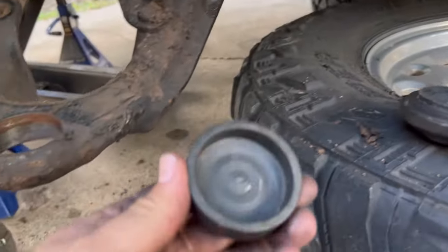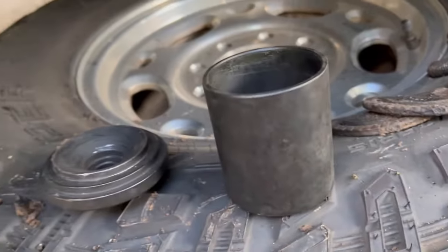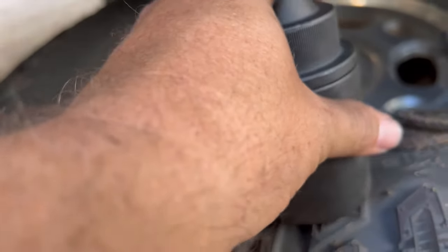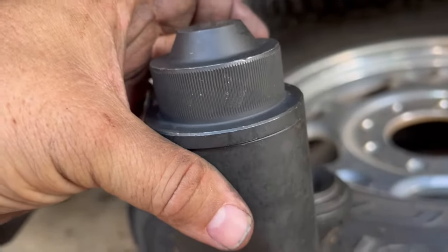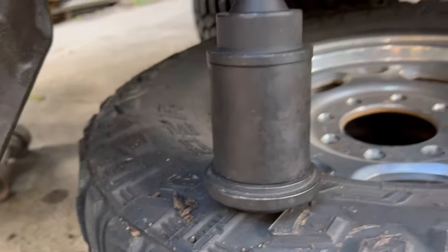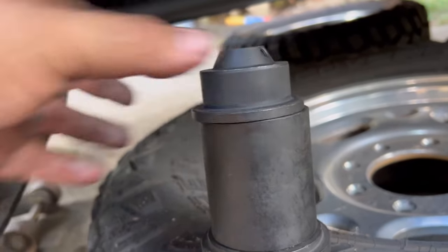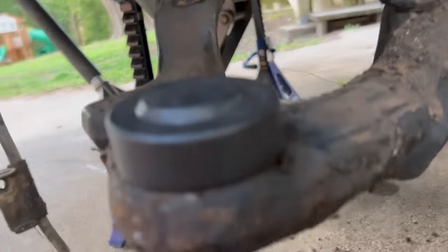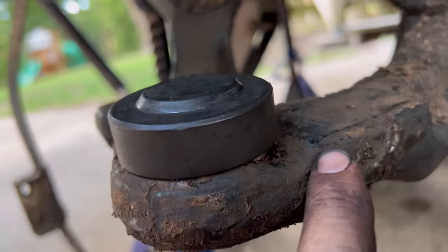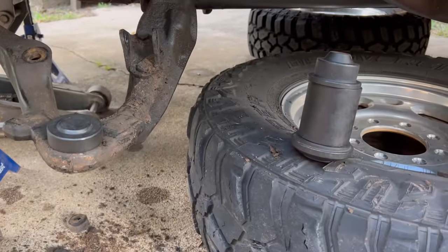So they go on like this. Take this top cap — you can see it's concave — set it right on top. Then take this sleeve, drop our ball joint in the sleeve, and you can see it fits the shoulder right there. Drop that into this bottom cap. We have our Zerk fitting hole right here, and that Zerk fitting hole corresponds to a divot in the lower control arm. We're going to get this rigged up and then I'll show you the press-in.